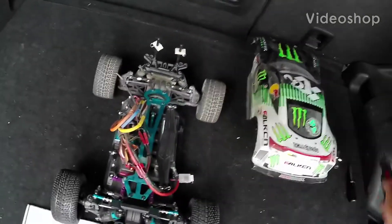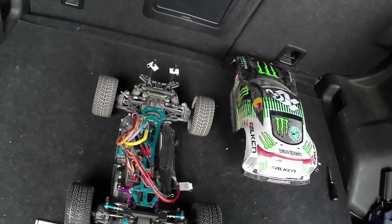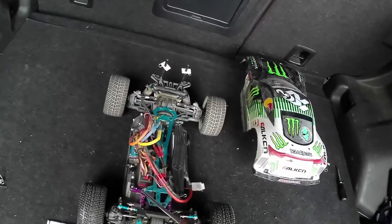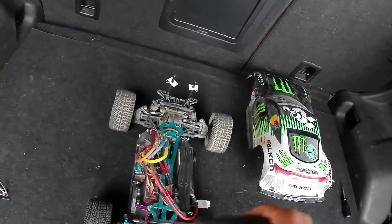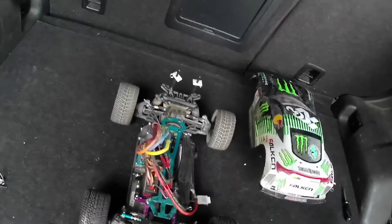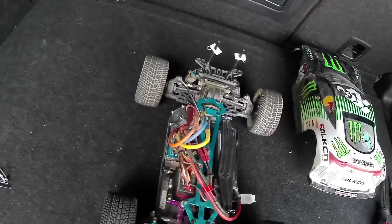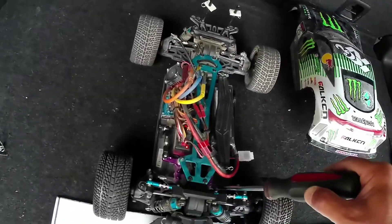This thing is so freaking irritating — it just won't steer straight at times. I ended up finding some binding on the joint here, and right here on the steering ball joints. I took a screwdriver and rimmed it out some, maybe a little bit too much so it's a little loose now. Seems to be a little bit better, but I think there might be some binding all the way down on the ball joints down here too.